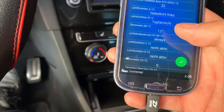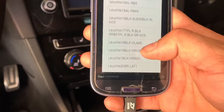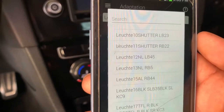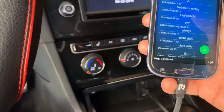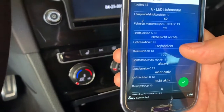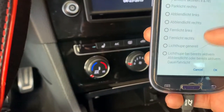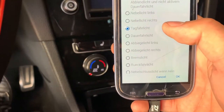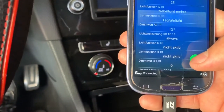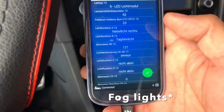Now go back, and on the same screen click on the one that ends with 'rb 5'. It's going to take you to a similar screen. Here you want to click b13, scroll down again, and select that one. Once you select it, press OK, then hold your check mark. Adaptation accepted — now both fog lights should be working with your daytime running lights.